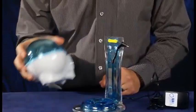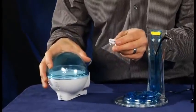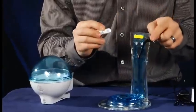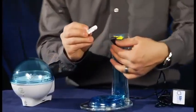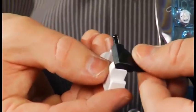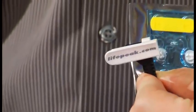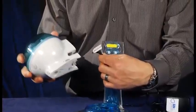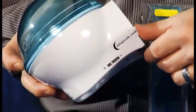Next, take the dispenser and locate the plug cover on the right side and slide it out from the back of the dispenser. Take the small plug sticking out of the table stand and snap it onto the back side of the plug cover. The metal shaft of the plug snaps into the C-shaped part of the plug cover and the back of the plug fits into the recessed area. Slide the plug cover back into the slot on the dispenser and push until the back is flush.